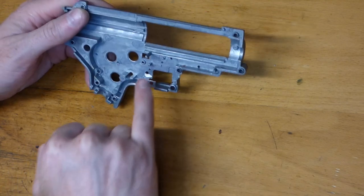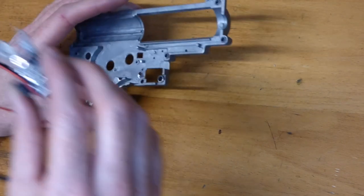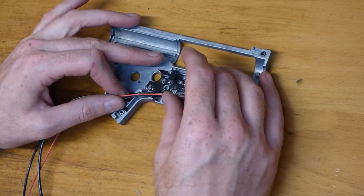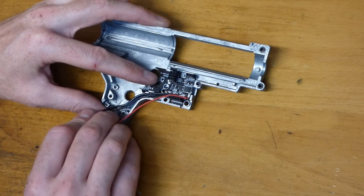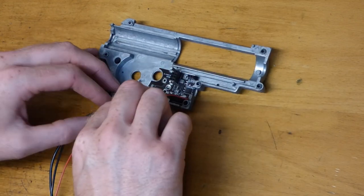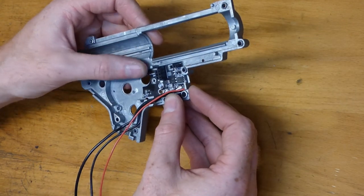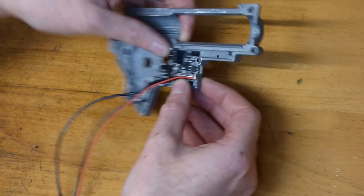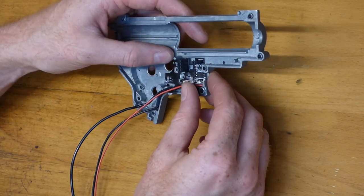So what I've done is taken that pin off and removed some material from here to allow room. Let's try again — gently, we do not want to force anything. We want to get to a point where it literally drops in. Getting the cables to sit where they belong as well — it's looking good. That's in, sitting pretty flush. On the flip side we've got space for those sensors. Every gearbox will be different — put your common sense hat on.